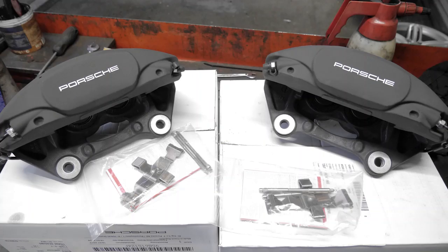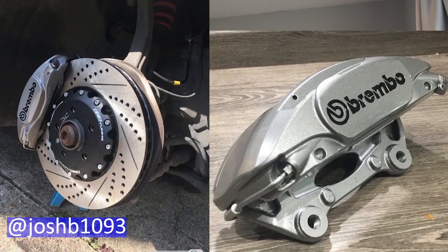Now let's move on to the next upgrade which is actually changing the calipers. This is an upgrade I've done myself and it is a four-pot Brembo caliper. It came off of a Q5 or a Porsche Macan and the ones I've got on mine are brand new from Porsche over-the-counter and the calipers cost me just shy of £600. If you were to buy second-hand calipers you never know if they're going to need rebuilding. They are a four-pot individual piston caliper and they mount exactly the same as the original caliper, so you physically take the S4 caliper off, take the hose out, put the hose back into the four-pot, put the four-pot back on. The only difference is it uses different pads.